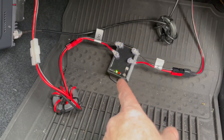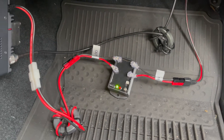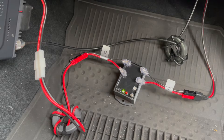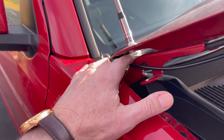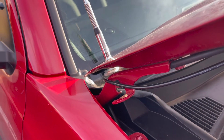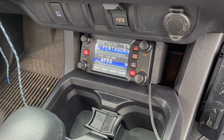Here's the wiring before I tuck it up under the dash — the voltage high/low cutoff and timer. As soon as you turn off the ignition, the timer determines how long it stays on. There's a choke for the antenna cable coming in and a choke for the power cable, so hopefully we won't have any RFI — any buzzes, noises, or whistles into the radio. One word of caution installing the antenna mount: you should run the coax on the outside of the hood mount. If you run it straight through on the inside, closing the hood will crimp and deform the cable and impact the coax performance.